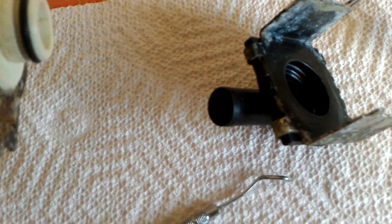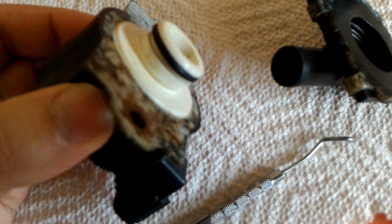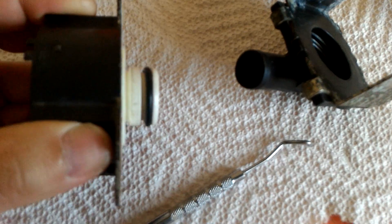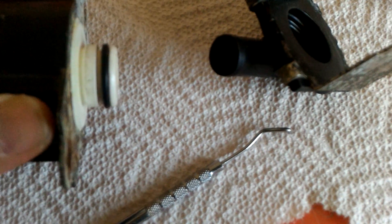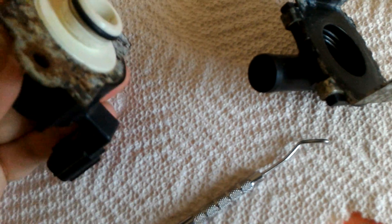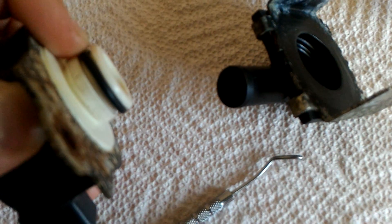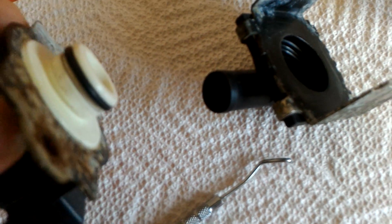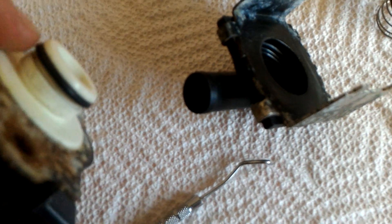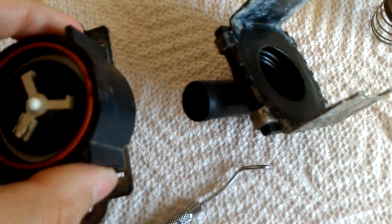Your other point of failure is going to be this O-ring down below. This one's a pretty universal size. If you have an O-ring kit, you could basically just pull this guy off and slide a new one on. Of course, clean the plastic area it's going to slide into. But if your rubber O-ring isn't brittle, you should be able to reuse this one. You just want to clean it thoroughly because this guy's been inside the charcoal canister, so it's probably pretty nasty.